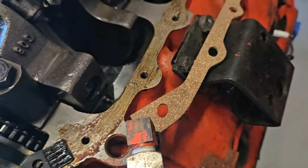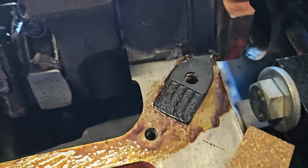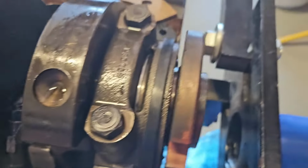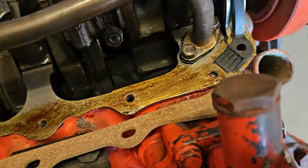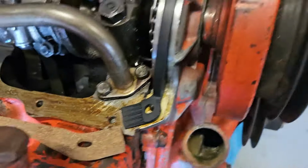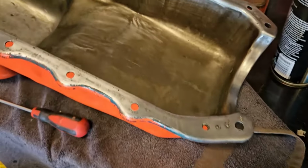And that's what I did on my last motor. Just a tiny bit of aviation former gasket. Beautiful thing, no leaks. And a bit of Permatex right in the corner there, either side of the rear. And now I'm going to set that gasket in, and I'll chuck a bit more former gasket on the top. And then the sump can go on, so that's all beautiful and clean.